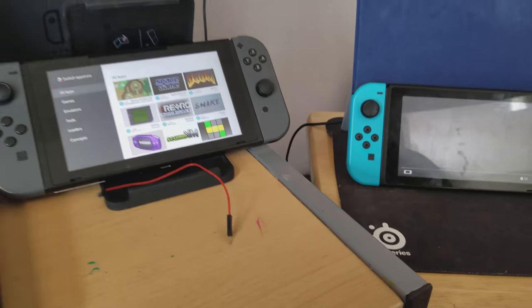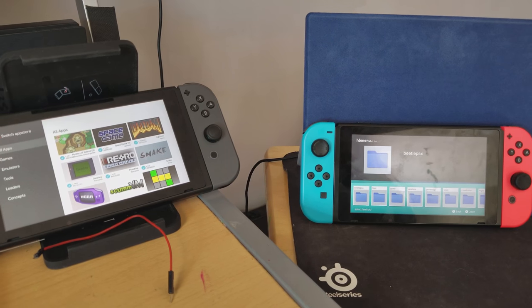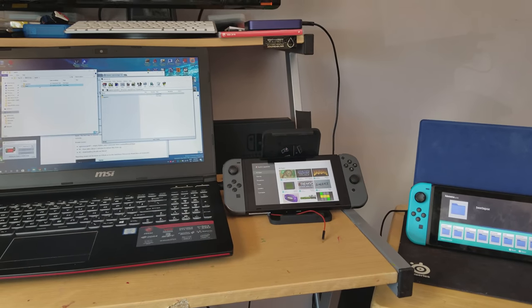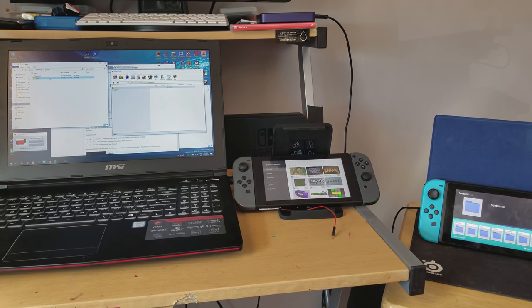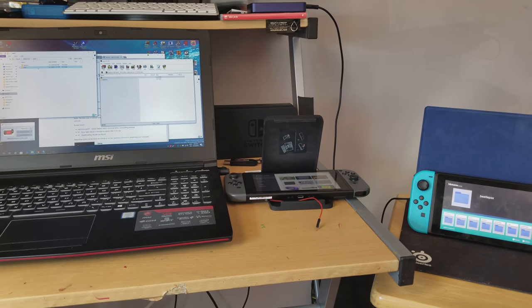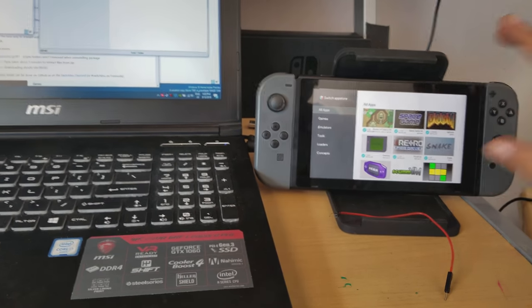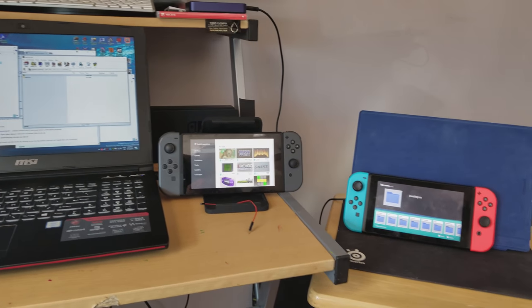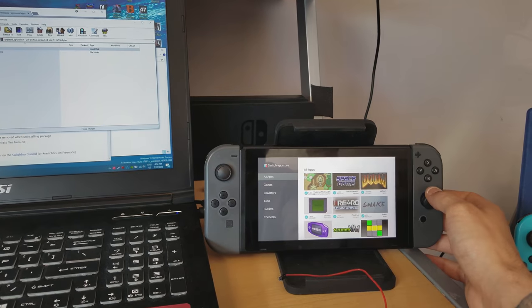No — see, some things just don't work. I don't want my switch to error out and crash. Some things may do that. If you run into an issue where your switch goes to sleep and remains black, hold the power button for about 10 to 15 seconds, let go, then push the power button again and your switch should turn back on.